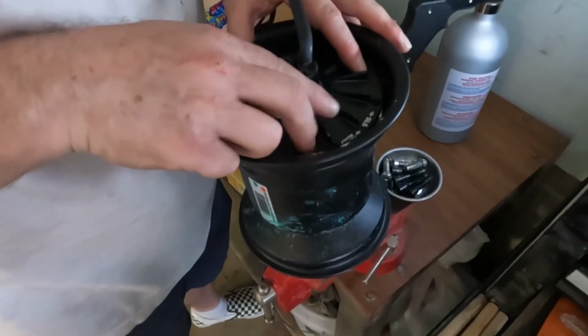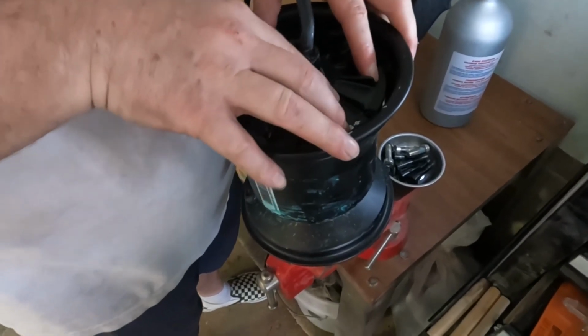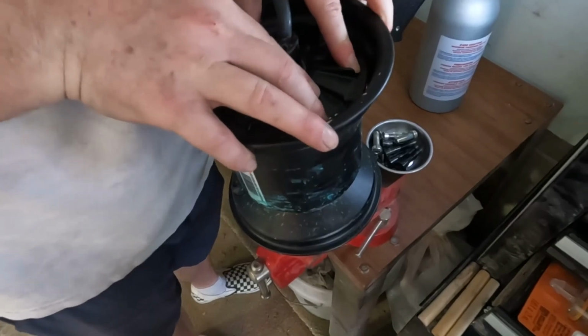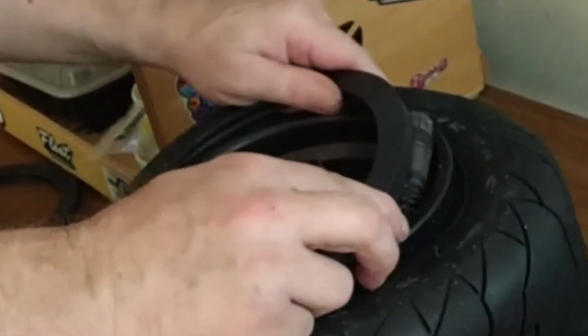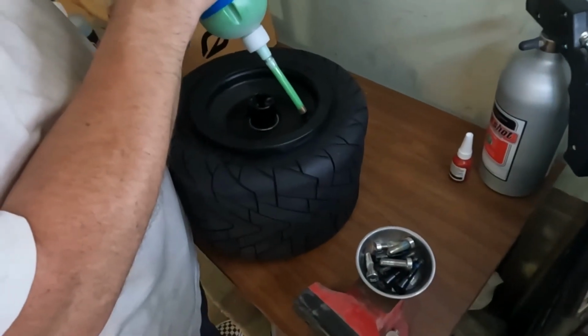Rotor in the hub, it's time to install the GTR adapter cover. The hub then goes into the fresh Enduro tire and onto the Lifesaver. We proceed to set the bead. We add some green slime and we put the GT back together.